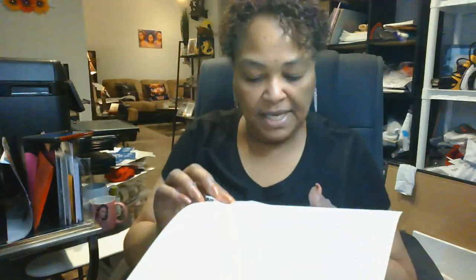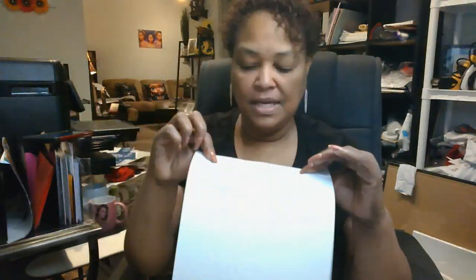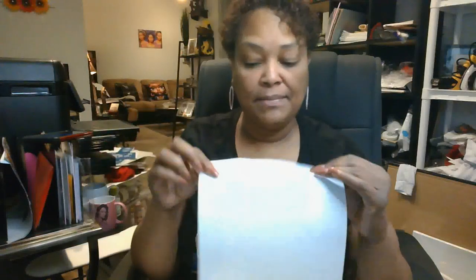If you have broken lines, then you can go in and you can do a print head cleaning and print head alignments. You can run those things and then do the print head nozzle check again, okay? Now, mine has always been where I might have just a few little broken lines in there, guys. But you can do a test print just to see what it looked like. My cyan doesn't show up like real, real vibrant on here, but it shows up vibrant when I'm printing.